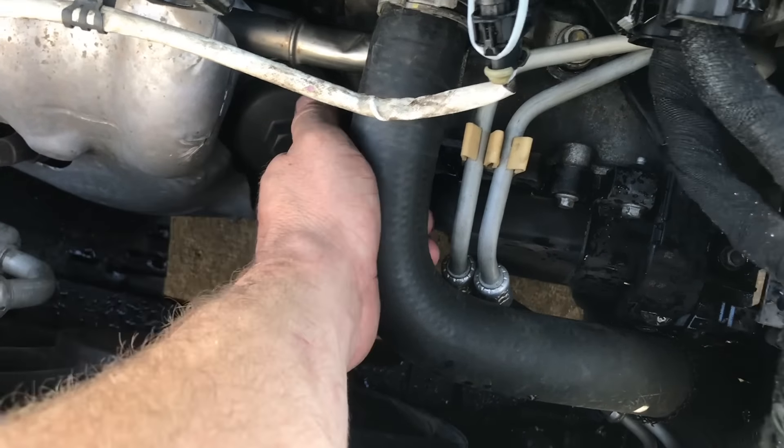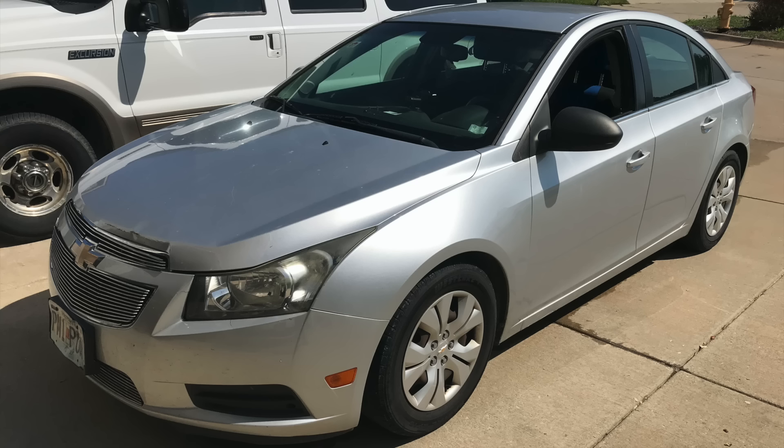And that's pretty much it — it's a pretty straightforward and simple repair. I've done dozens of these thermostat replacements under warranty, both the thermostat replacement itself and the entire housing. It's a really easy job you can do yourself and save some money. As I mentioned earlier, the reason I use the plastic thermostat housing from GM rather than an aftermarket aluminum one is because the owner of this vehicle has had three aftermarket thermostat housings put on and they have either leaked or set trouble codes for a bad thermostat heater or engine coolant temperature sensor. We decided to use the ACDelco part — yes, it is a plastic housing and may be a little more prone to leak, but three aftermarket aluminum ones have already failed, so we're going to see how the GM part does.